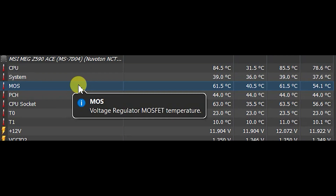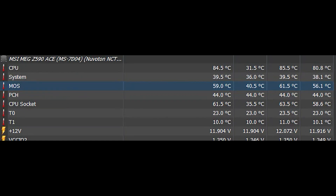Taking a look at some performance numbers now. The pump section actually has its own fan pointed towards the VRMs. The peak temperature for the MOSFETs started at about 61.5°C, then after a minute or so fell to 60°C, then down to 59.5°C, and eventually after a few minutes reached 58.5°C. Left on for a while, it would get as far down as 54°C under load, which is a very useful feature to have.